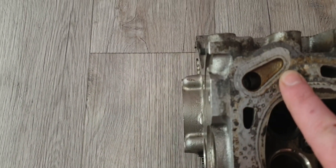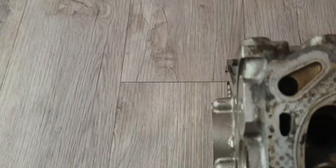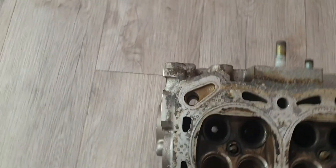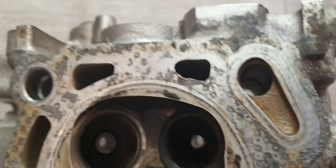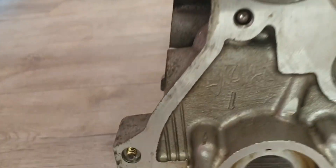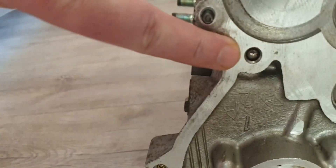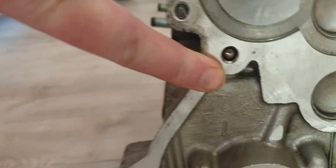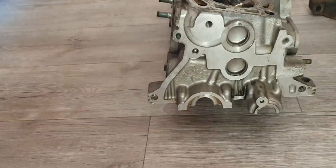It comes up through this little hole, and if we match it to the cylinder head, the oil will come up through here and then it'll flow into where the head stud bolt bore is and cut out. So I was like, well, that's weird — how does that actually go through? There's a little hole sort of halfway down the oil travel which I found, and that oil for that hole goes to this little ball valve. From there, presumably it goes into other parts and apparatus which will distribute it around the cylinder head.